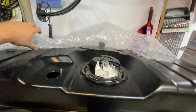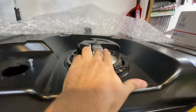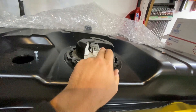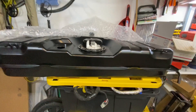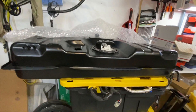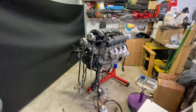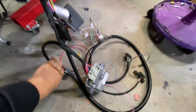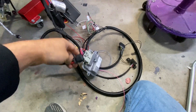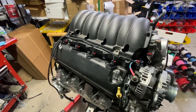This is the brand new fuel tank setup, so I got the connection set up that will go to that fuel connector. This is your fuel pump output directly to your engine. I just got to make a cap today for that so I can bring everything over to the shop. For the test fire, I'm not going to put this tank in — I'm just short on time — so we're just going to throw the harness on and start it with the LS style fuel system regulated at 57 psi. This will still work — you just use the power output and it will still turn on the pump. Anyways, here's another update on the build. Thanks for watching.